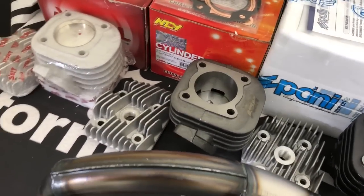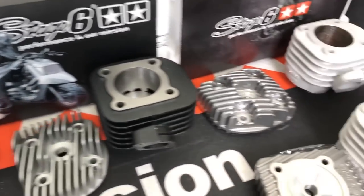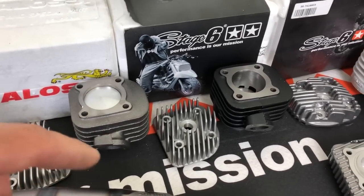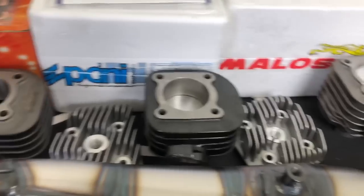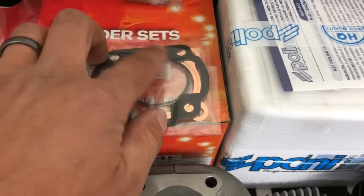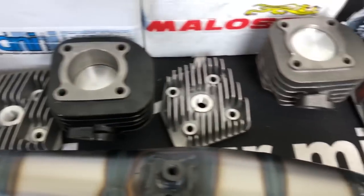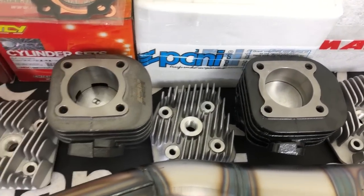When you're spending more money you're getting better pistons and better design — it's not just about the brand name. The Corsa comes with reeds, a spark plug, and a wrist pin bearing, which the budget kits don't include. So if you're already changing those parts, having them included is a nice bonus. For any of these kits, I suggest using Honda Bond or Permatex on the base gasket on both sides. Make sure your mating surface is really clean, because if you get an air leak you're going to have a problem. The O-rings seal a lot better than flat gaskets, and I'd periodically check torque on the flat-gasket kits.